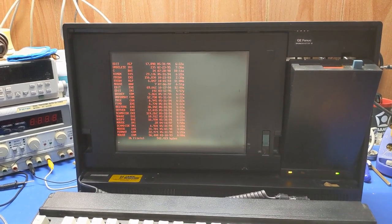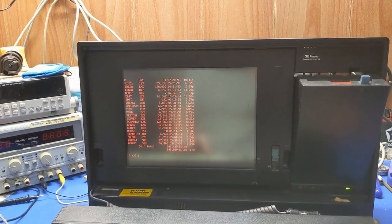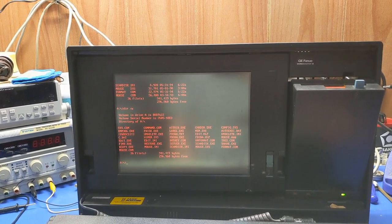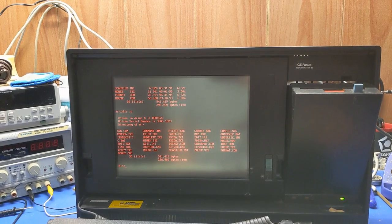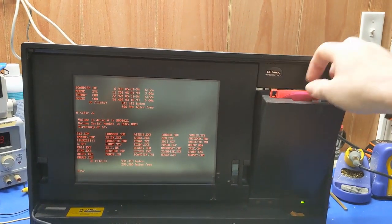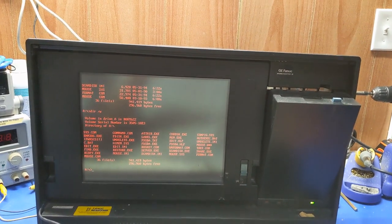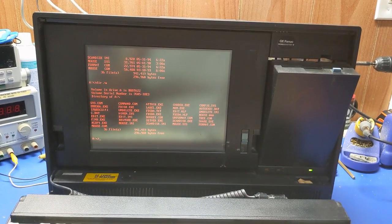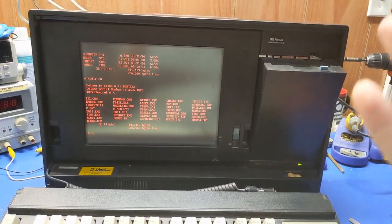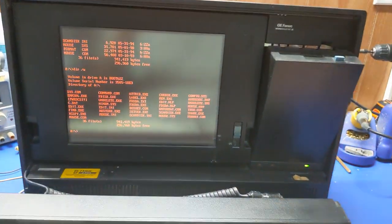It's a PC. I can run DIR. I don't even know what's all on this disk. And it's got the power SCSI hard drive, hardware, drive controller stuff. So, yeah, and that's the problem. There's no storage unit or solutions for this up until recently. There's a product that came out this year called McIDE, which is a microchannel-based XT to IDE, uses the XT to IDE BIOS, and it's a microchannel-based IDE storage solution. So we can finally bring things back to normal with this.